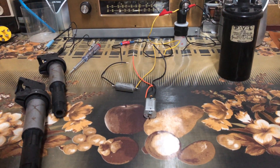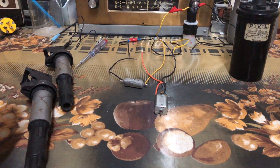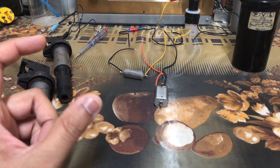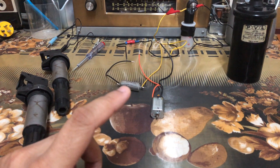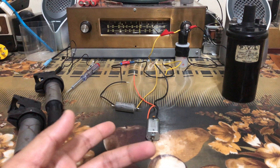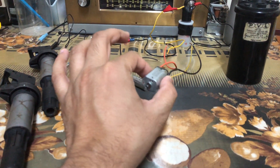Now coming to the testing method. This is similar to how a traditional ignition system works using a distributor. The distributor is driven by the camshaft and there are two contact points inside that open and close. This opening and closing causes the voltage to change inside the ignition coil — the field builds up and collapses, inducing high voltage into the secondary, and hence you get a spark at the spark plug.